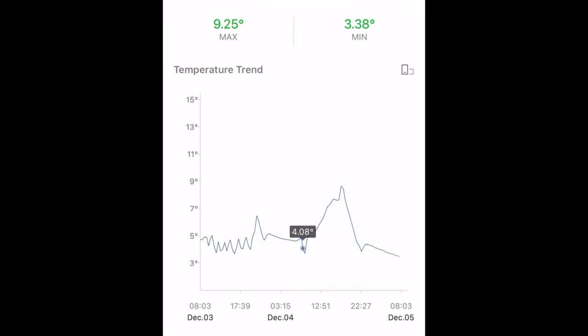Most days in these weeks had daytime highs between 20 and 25 degrees. Between 6 and 25 degrees the fridge works great on gas even without the fans running. What we did notice when running both internal and external fans was that we could dial the fridge down to an 80% power setting, meaning we could run the fridge more efficiently and save some gas - a win considering we change a gas bottle every 10 days. During testing we had two very similar hot weather days and found an internal temperature difference of 2.2 degrees - recording 4.2 degrees with the fans running and 6.4 degrees without.